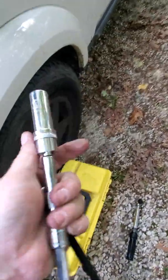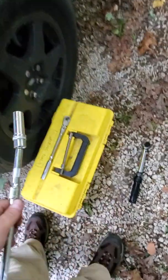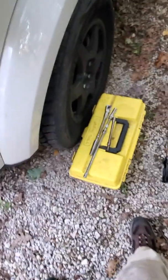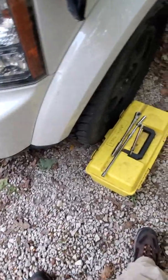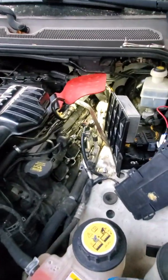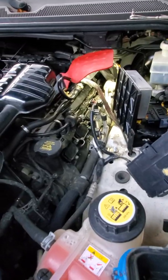Hopefully you've got enough angle on your plug with your Ford wiggly knuckle tool. Remember it's 15 foot-pounds or 20 Newton metres. I've got two torque wrenches and I don't trust either of them — I've got to get them calibrated. So I'm setting it a little bit lower; I'd rather put it in not too tight than too tight.